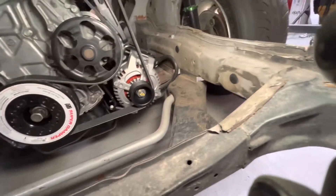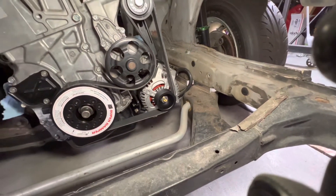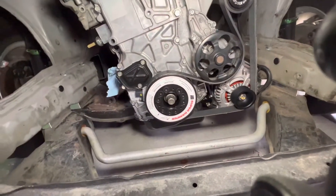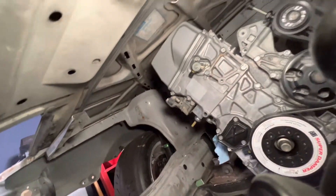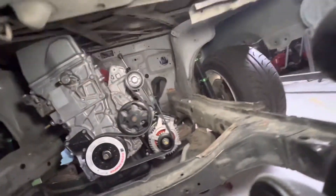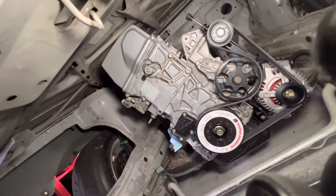Part of that is because I wanted to mount this with only one inch spacers instead of — I don't know how many people would have done this swap, but I think usually they use like one and three quarter inch subframe spacers, which I think is just a bit excessive. The K24 is really tall, so we're going to make this work with one inch spacers. The hood's fully closed and it's barely touching that support, so I think we should be good. We'll just cut that off and call it good.